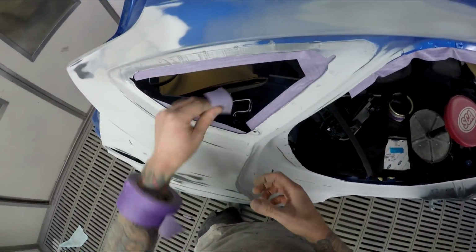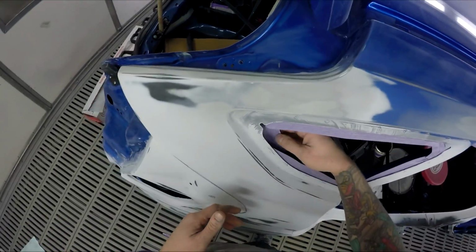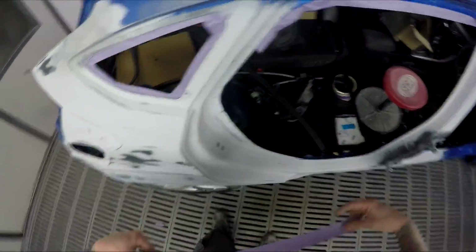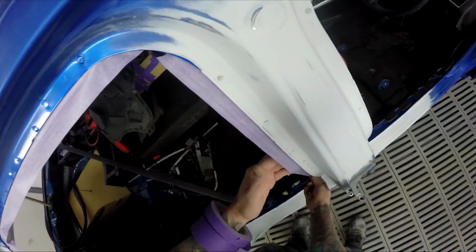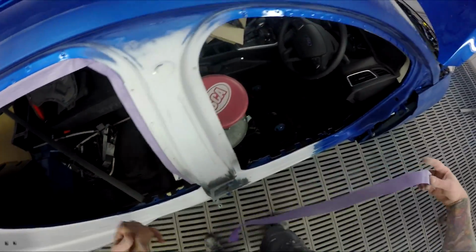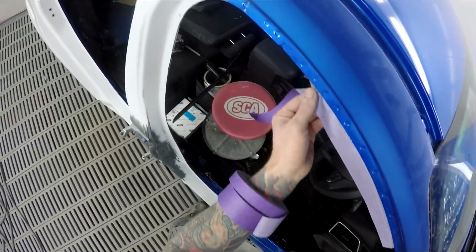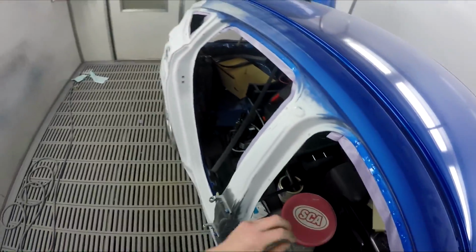It dries so quickly. And now that I do have that UV curing light, I can use UV all year round. Previous to having that, it was only really something that we could use in summer, or at least on sunny days. So yeah, pretty handy. Otherwise, you'd have the first choice, which would have been maybe a bit of 1K primer, like etch primer or something, put that down and then use some wet on wet primer over the top of that.